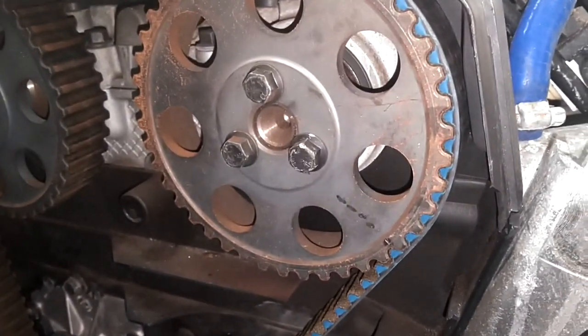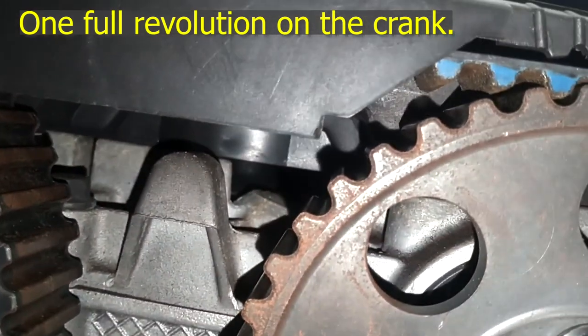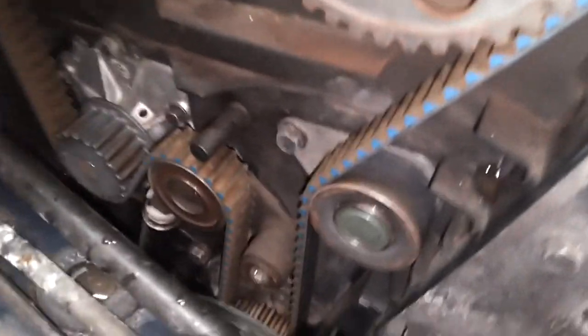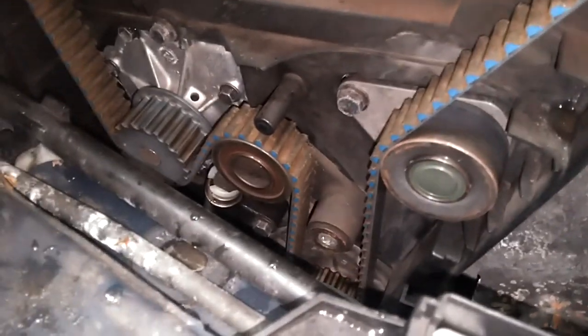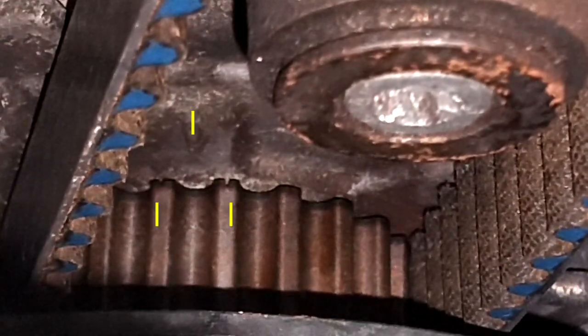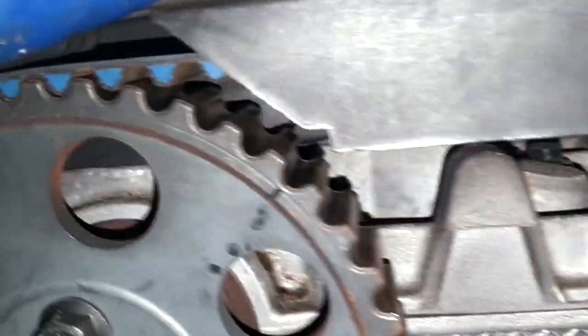It appears I'm about 180 degrees out on this timing belt. I had a mark there and I've got to line it up with that notch. Let me pull this skirt back, roll it around, and get the timing on. Make sure it's on the crank because the crank is your focal point. The timing marks on this one are dead on — the little notch on the crank pulley at the oil pump nipple is dead on, and the cam mark is right in that notch as well. Timing is right on spot, so we shouldn't have to mess with that.